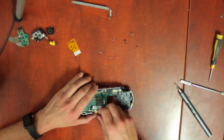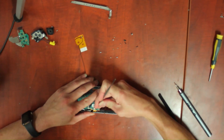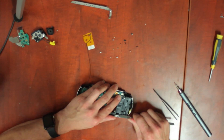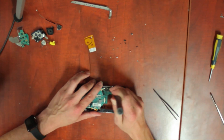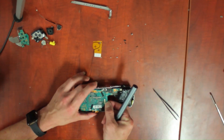Sorry, I lost the footage here — my SD card was full and it took me two minutes to realize. The right button board is easy to remove, and so is the power connector. Both of them need to be saved as they will be needed for the upgrade. We will also be using the speakers as they are reused. Now we're ready to remove the main board — we will need a lot of the screws, so remember where they go.